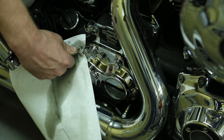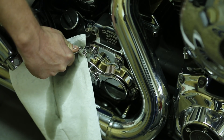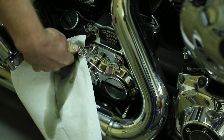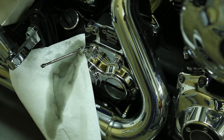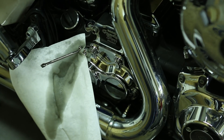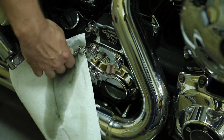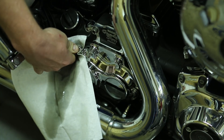I think we've got just about a full bleed on this. I'm going to try one more time — pull the bars in, crack the bleeder. No air that time, just straight fluid. You can hear the master sucking. So we're going to add a little bit more fluid to the fill line, then put the master cylinder cover and gasket back into place and should be good to go. Give this one more since I sucked a little air in there — yep, all fluid, just the way we want.